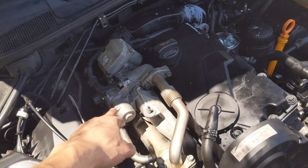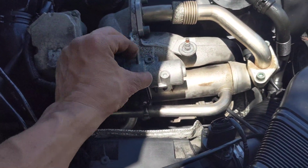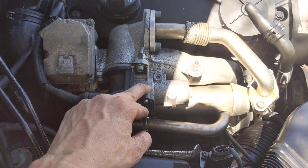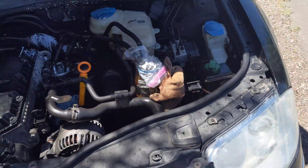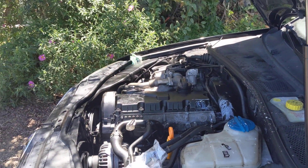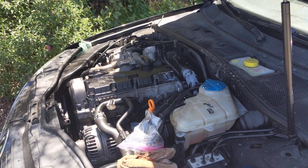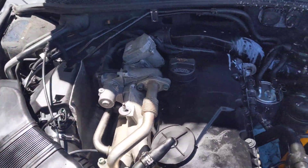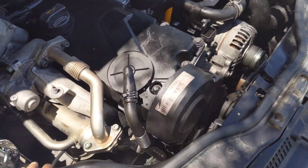How I cleaned the EGR out was I just used a screwdriver. Then I took this plastic housing off the metal piece, because there's some electronics in here that I didn't want to wash. I happen to have an ultrasonic cleaner, so after scraping it with a screwdriver, I stuck it in a ziplock bag with some Dawn dish soap and a tiny bit of engine degreaser — you don't want anything too alkaline. I stuck it in the ultrasonic cleaner for about two hours at 60 or 70 degrees Celsius, and it cleaned up so clean. Since I was in there, I also took this thing off, took off some other hoses, and cleaned that out.